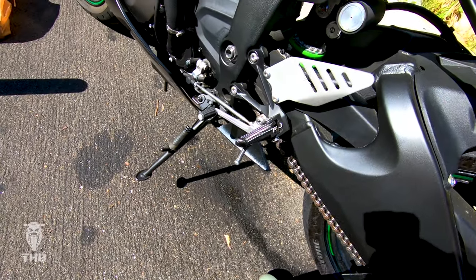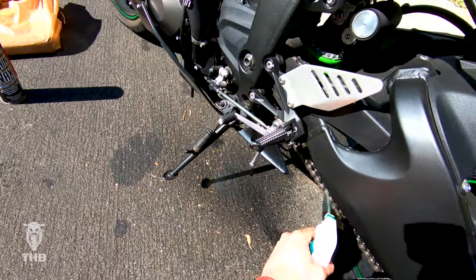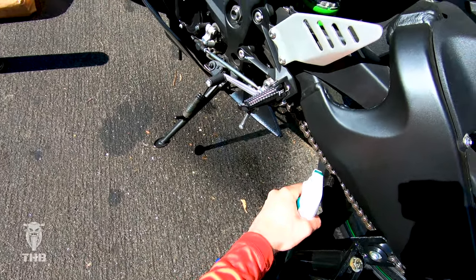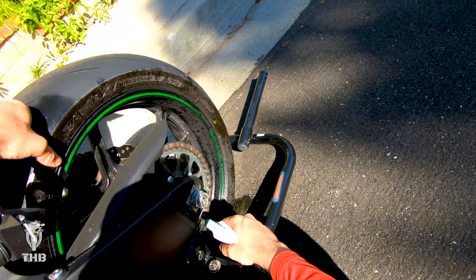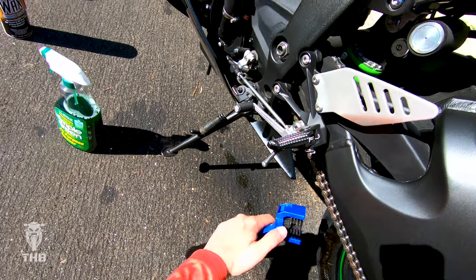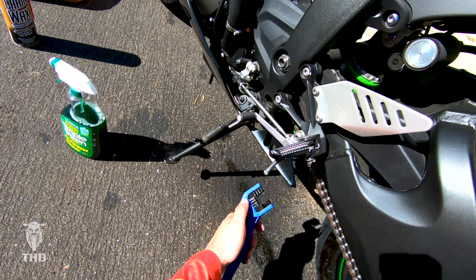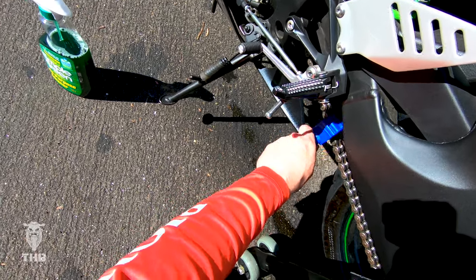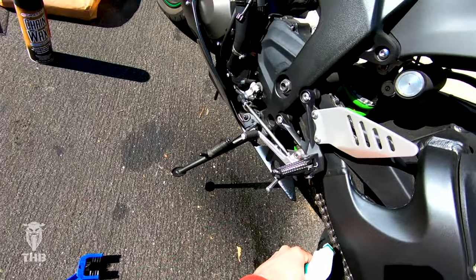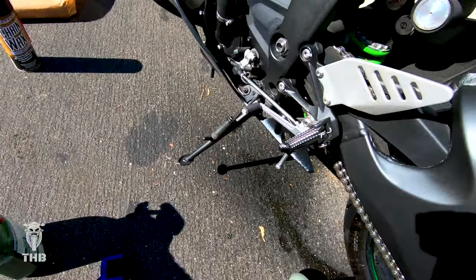It's been about two minutes now and everything has stopped dripping. So I'm going to go ahead and re-spray this chain, then we'll get to scrubbing it down and getting the thicker, heavier gunk off. Make sure to get the rear sprocket nice and clean as well. I make sure the outside of the chain is rubbing against the middle piece of the brush so I can get the top and bottom. I brush, then reapply, let it sit for another minute, and scrub again.